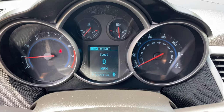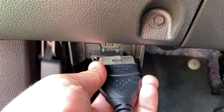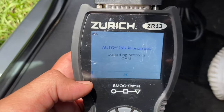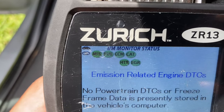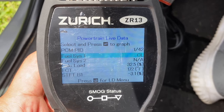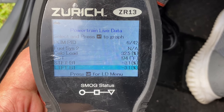Finally, here we are — I wanted to show you before I uploaded the whole video some bonus footage of the way the car looks when it's fixed. I'm in the car, I just started it up — there's no check engine lights on. Let's plug the OBD scanner in. No codes — very good. And we drove it all day yesterday. Before, my short-term fuel trim bank one was around 30%, and now it's stabilized and it's in the negative range where it should be. The problem is fixed.